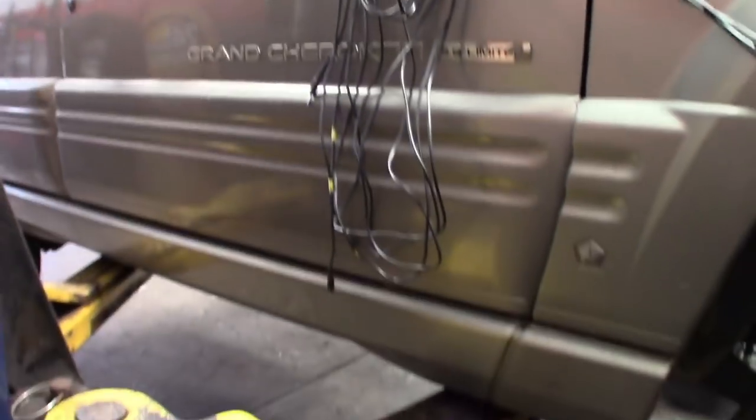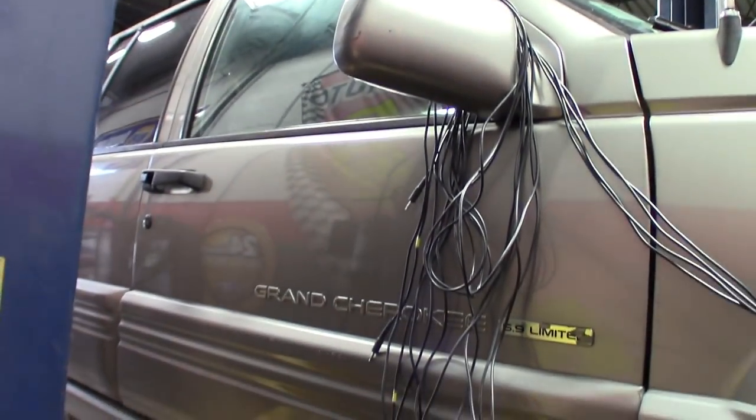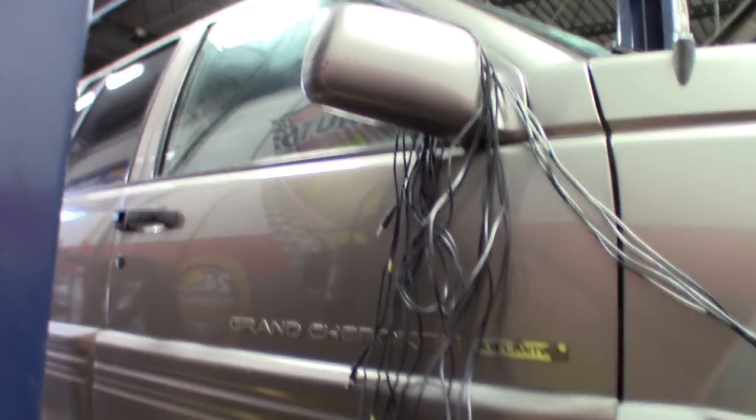You can kind of see where I got them clipped. That one's for the spindle - I'll be able to catch the loudest noise on that channel. I got one on the lower ball joint bolt, one on the upper ball joint zerk fitting. Routed all the wires out of the way, make sure they're not going to get pinched or rub on anything. Let this thing down, tie the wires up. Threw another zip tie up there - clear of the wheel, nothing's touching. Hung them on the mirror, brought those inside the window.